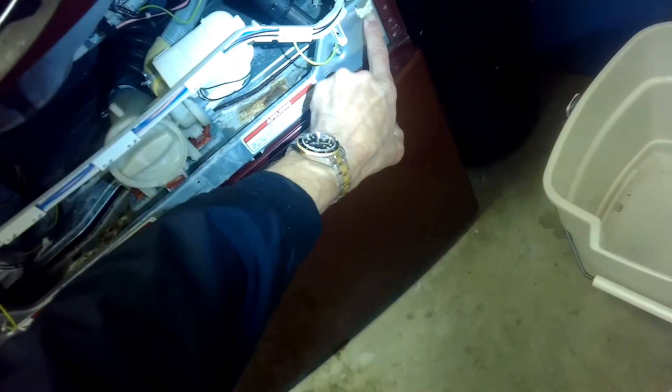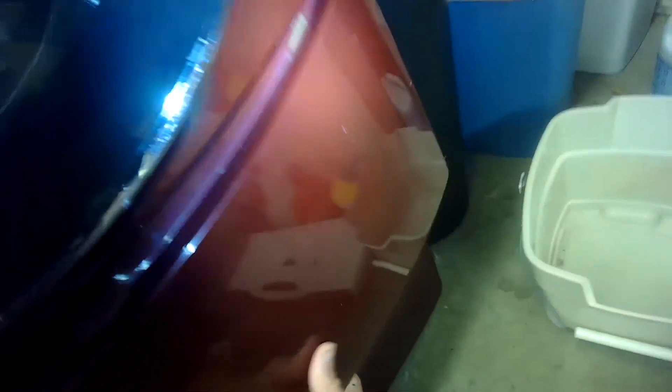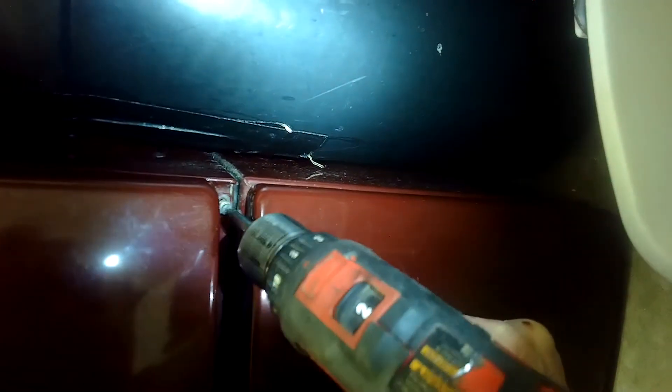We reinstall this panel. Whenever you take off that panel and you're going to fix something and then want to test it, you have to make sure the panel gets back on for the test because this switch has to be closed, and that's closed by the panel pushing in on it. So this is going to go up and then in. Open this door to make a little more room, close the door. Then we're going to add the screws on the bottom — these are Torx screws, I think Torx 15.